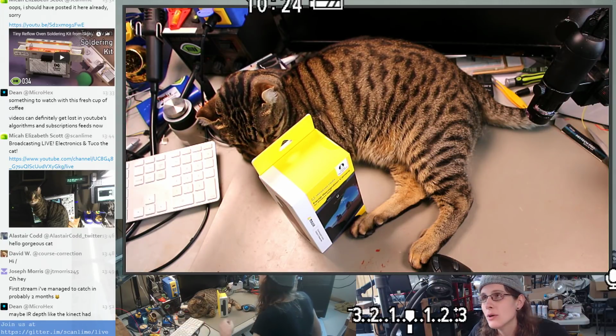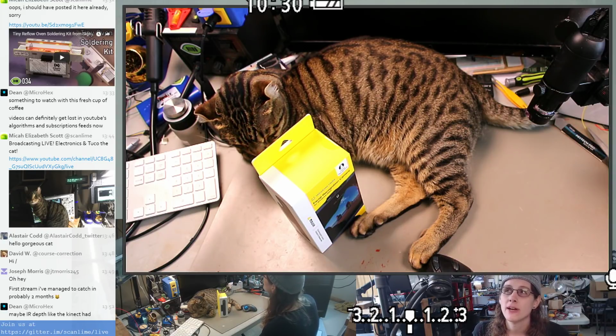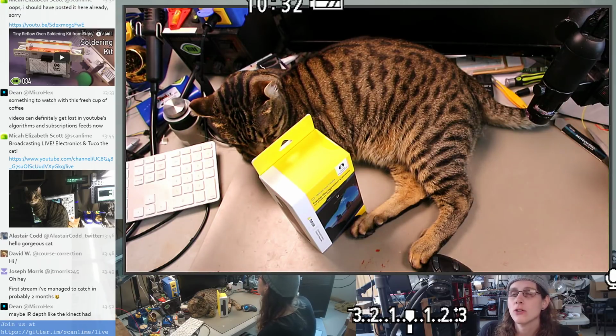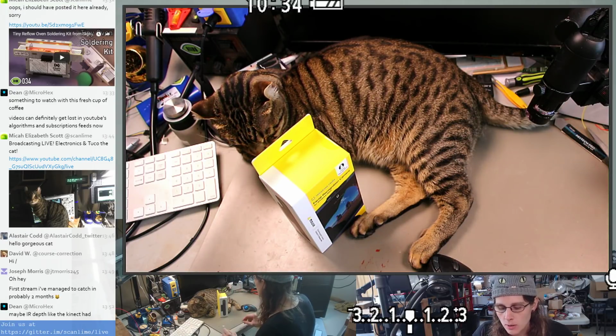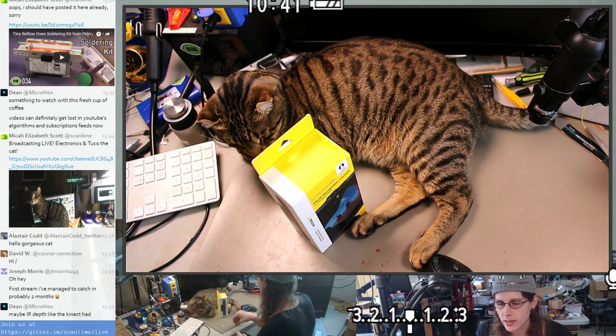So with those, you can log anything that goes over a USB wire pretty much. You can get very accurate timestamps. You can do it without affecting the traffic that you're trying to log at all. It's very powerful, but those devices aren't cheap. Even a really basic one will set you back a couple $100, and one that handles high-speed USB will generally be several $100s at least.